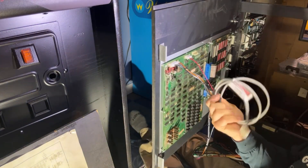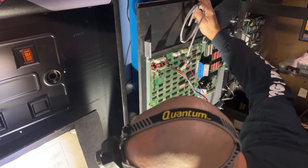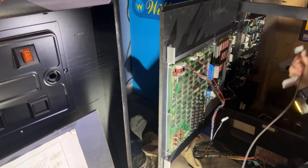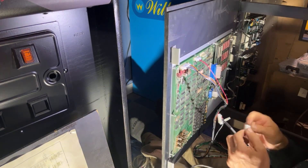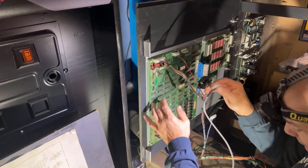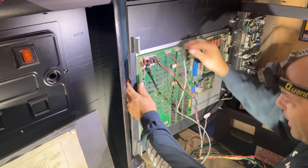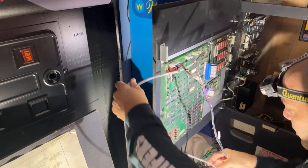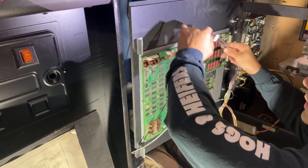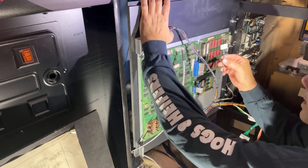Now 2J2 - this is our monitor wire. Here's our plug for our monitor cable. Pin number one is red, then green, blue, ground. The little prongs are upright, so it's going to go this direction and plug in right here. There's our video plug. I'm going to have to go get some wire clips - the downfall about these doors is the wiring harnesses are on them but the door swings all over the place unless you prop it open.